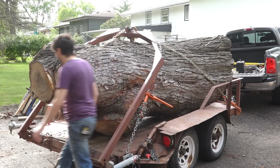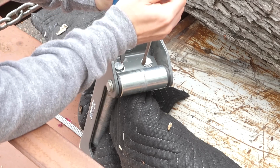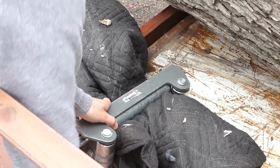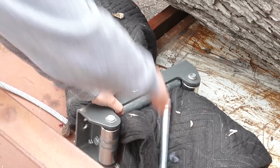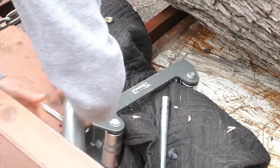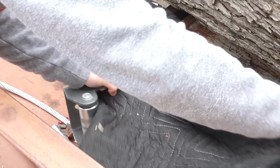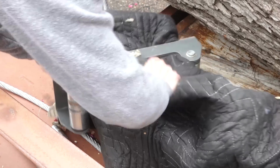I'm a little rusty. So now that I'm back, I have the right tool to actually remove the fair lead clips for the rollers. I can pop a roller off, pull this stupid blanket out of here, and get this fair lead thing bolted back onto the front of the winch, which I will do with something other than an adjustable wrench. Should be a lot easier.